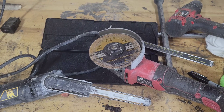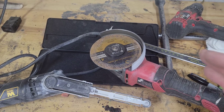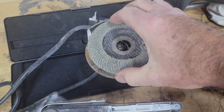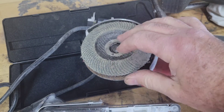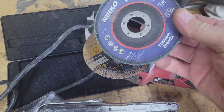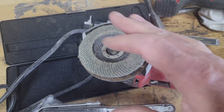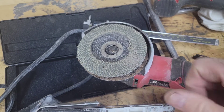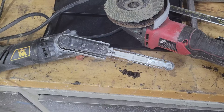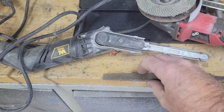Honestly it's not that hard — you might be shocked how easy it is. We used a big machine but you don't really need that. You could do it with one of these flap disks. Start with a 40-grit and knock it down pretty good, go nice and slow, take it off slow, don't put any weight on it, don't try to do one section really hard — just work it gradually. Take your time, there's no hurry. Then just finish it out with a nice flat file. You'll also need a gram scale.